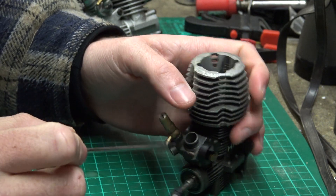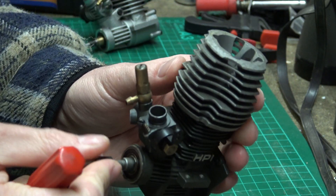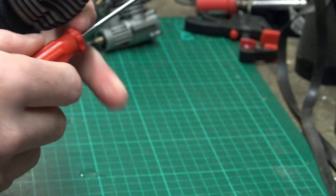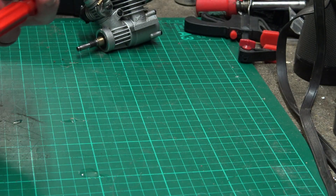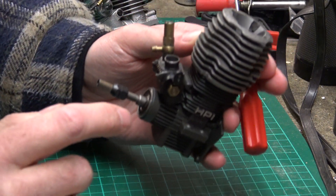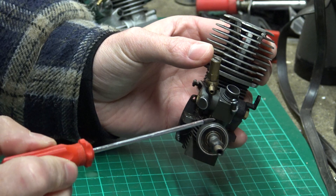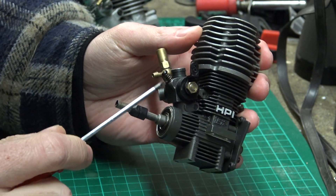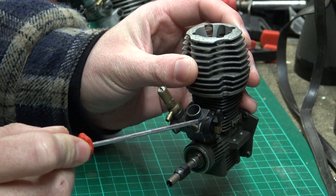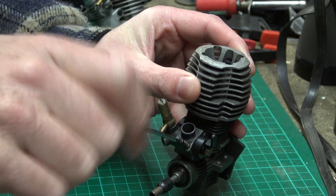This is obviously a T-15 engine from an HPI Rush Evo. So this is the tick-over screw. You can tell which one's a tick-over screw because it will usually be the one with a little spring on the outside. Not all of them have a spring on the outside. The one on the MP9 hasn't got a spring — it's like an internal spring on the inside, so it just looks a bit like a needle. But usually they have a spring on the outside of the screw, so you can tell which one is the tick-over screw. If you're not sure, it's the one that would adjust the throttle.